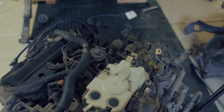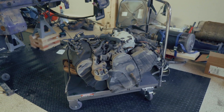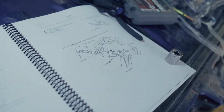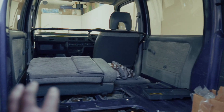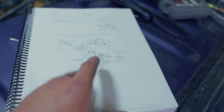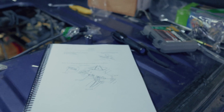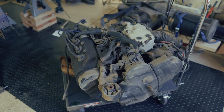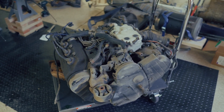I'm going to do my best to get the transmission off while keeping the engine on the pallet, and this pallet worked out pretty smoothly. The manual has its own method — basically a hoist triangle with a chain mounting to the engine and a floor jack underneath — but that just seems like too much work. What I'd say is: jack the whole thing up and use one of these 500-pound hydraulic lift tables. Big success.